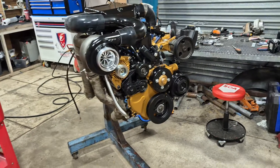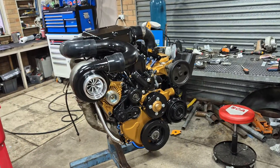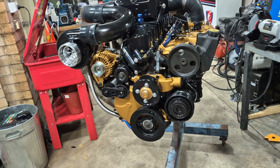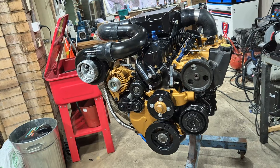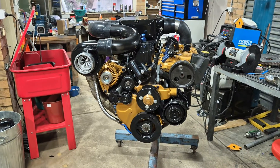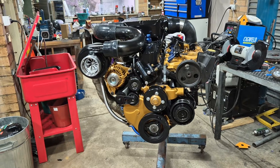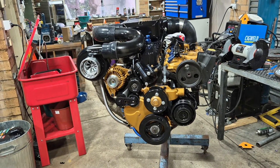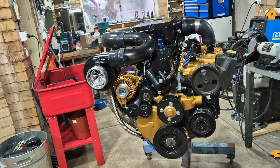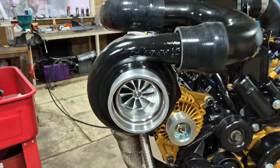I will go into some detail about that at a different time, but I just wanted to show you the engine on the stand. I didn't take any videos of me assembling it due to the amount of time I had lost, so this will be just an incremental update. The engine as you see it is a 4 litre, 30 thou over, stock crank, forged rods, forged pistons, LS valves, 515/510 lift cam, in around the 218-220 duration somewhere there.